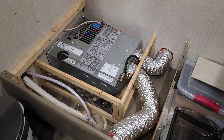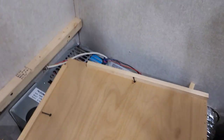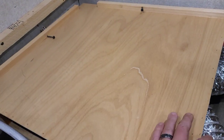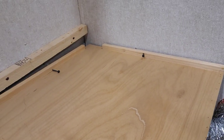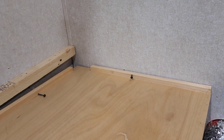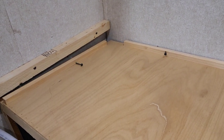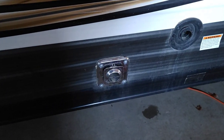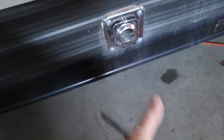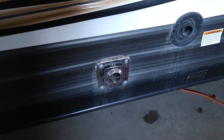Nice and warm — we got heat again. Now it's time to put the box back together. You can take the whole box out if you want, but I personally pop the staples so that way I can just slide this back out real easy in the future to flip that switch — that way I don't have to take the whole couch out if that switch ever flips. Another thing you could do is drill a one-inch hole right over there; I just don't have one with us here so I'll leave this loose until I can drill that out. The only thing you've got to remove on the outside of the camper is these four screws, and this vent just slides out. Once you slide that out, that makes it real easy for the furnace to come out from the inside once you have all the bolts and everything taken off — so that's how she works.